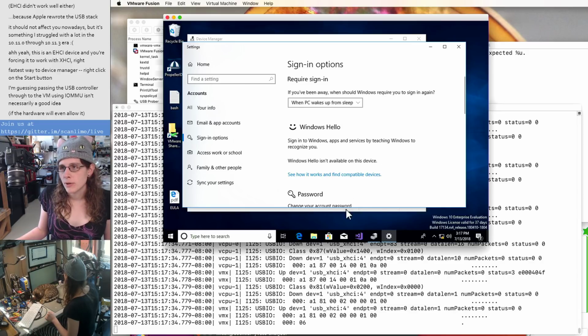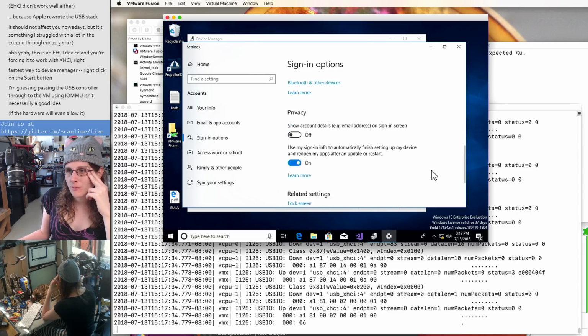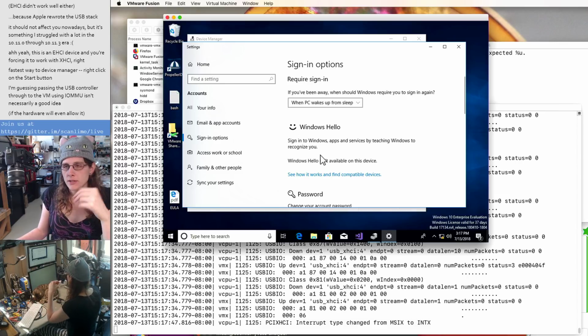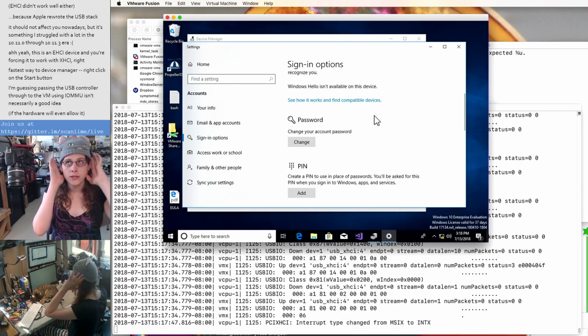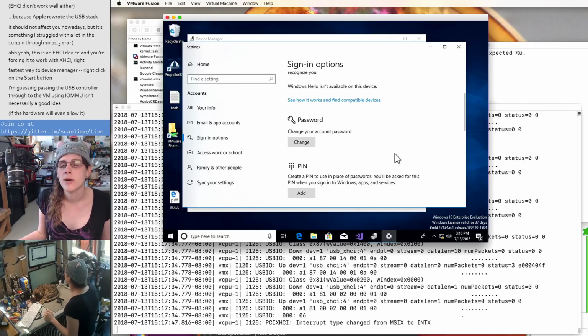We could also try running this part again without the XHCI experience, because it could be that's interfering with whatever this is using to recognize the device. I would be surprised though. I assume it's probably just looking for some aspect of the descriptor and then starting, you know, either it's a completely normal UVC camera that just has specific capabilities, or there's going to be some other way of putting it into a secure mode that they would be initiating once they identify a compatible camera.